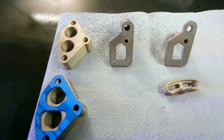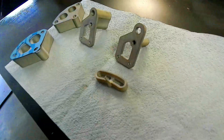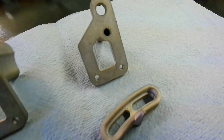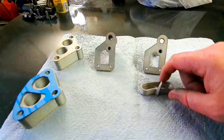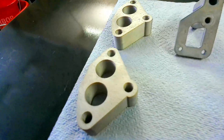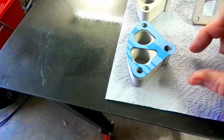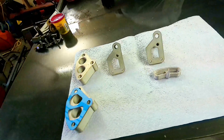So I showed you the CAD file and how we did everything, then sent it over to my buddy for the 3D printer. Here's the first look at the parts coming back — I'm really pretty happy with the way everything turned out. We have two different brackets for this adjustable pointer and our two block adapters for the remote mount water pump. Unfortunately with those, I got just a hair off on the bolt hole somehow — I don't know how it ended up stretching inward instead of outward, but it was really hard drafting one off of that gasket.